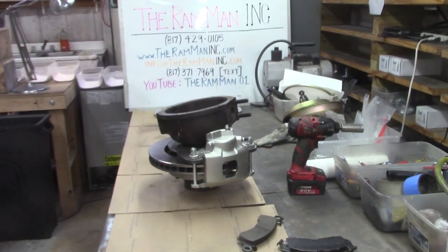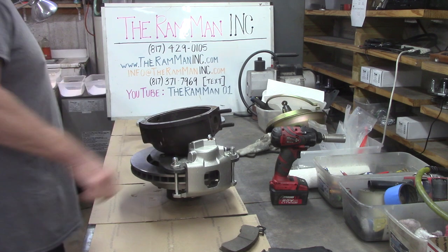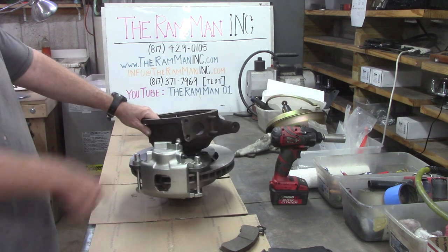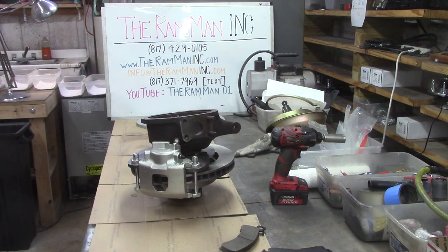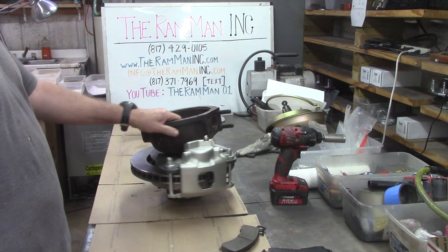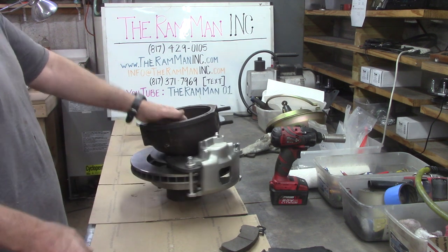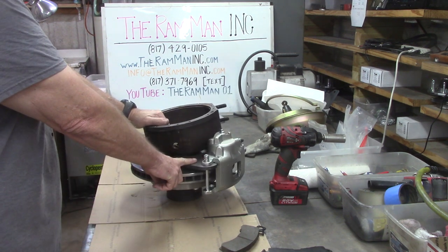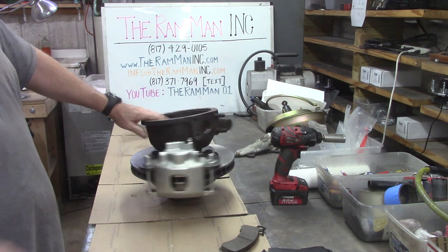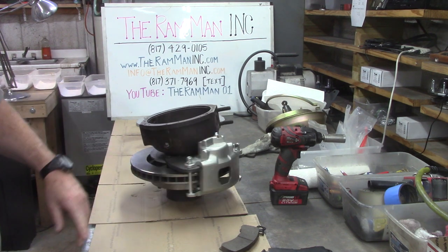Hope that helps you out for some of you folks that were confused. Yes, we have a disc brake kit for the big knuckle — we always have. We just don't sell very many of them; it's literally about one in ten. The calipers, pads, hoses, and pin setup are the same on both of them, but the caliper plates are slightly different, the spindle plates slightly different, and we have a couple different spacer arrangements, which allows all this to happen and bolt together quite nicely. If you can tell, it's quite well done. I'm more proud of this than some other things.